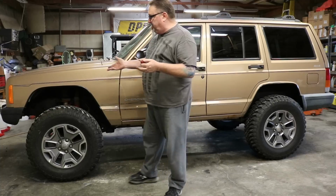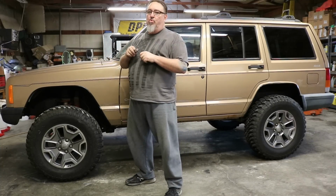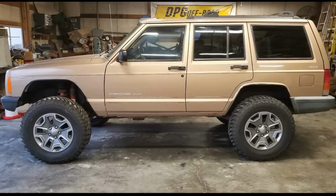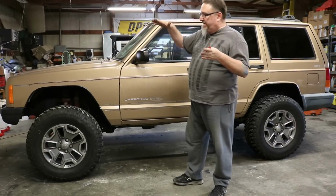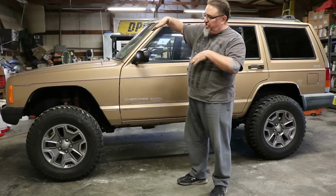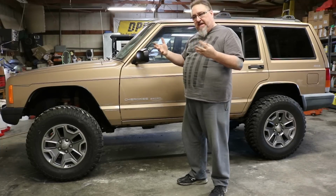And you know, with a 3-inch lift, when we trim the fenders, it looks like the Jeep has more lift than it really does, because lifting a Jeep creates a bigger gap between the tire and the fender. Well, so does making the fender bigger. So rather than lifting a Jeep taller, higher center of gravity, easier to tip over, all of our operating angles on everything, drive shafts, control arms, track bars, steering linkages, everything, the taller you lift it, the steeper those angles get. Your handling starts getting twitchy and sketchy.